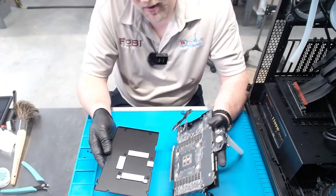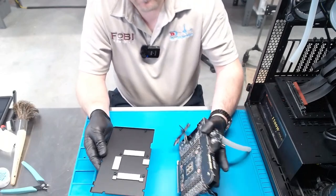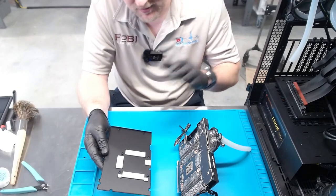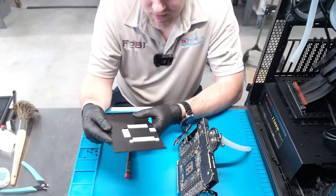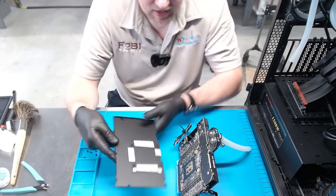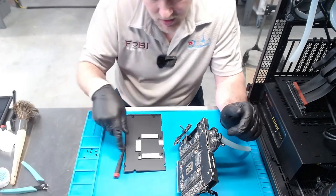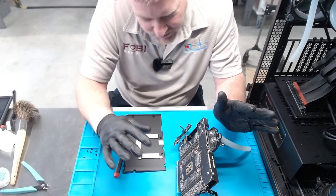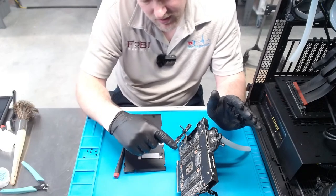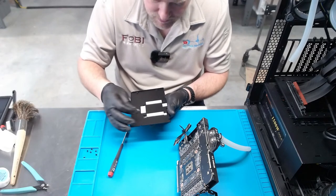Oh, yes. Okay. So you can see I was being very careful about that. So this is the back of the 3090. And this is the Founders Edition, which you can tell has got the V. It's a very odd-shaped board, but it is what it is. You can see how little heat sinking they have. So they only heat sink the memory modules themselves, but a lot of these chokes and stuff over here also get pretty hot. So I'm going to goo all of this, like every one of them, which is going to start with me pulling these guys off.